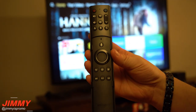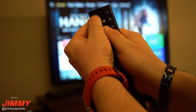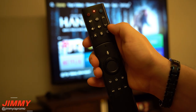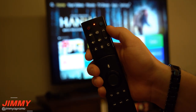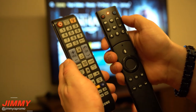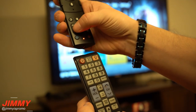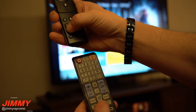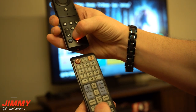To set up and program these buttons, go to your red power key and your mute button and press and hold both together for about three seconds until you see a red light. Once you see that red light, it's in pairing mode. Now select the button you want to set up — let's say the up button. Once you hit that, take your regular TV controller that's already set up, place them about an inch away from each other, then press and hold both the corresponding buttons for three seconds. When you see a blinking green light, that button has been successfully set up.